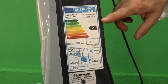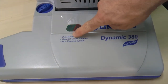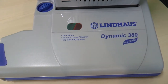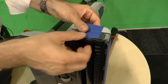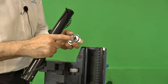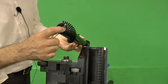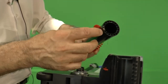Dynamic is a Class A machine for energy efficiency. Dynamic Echo Force is a dual-motor machine — it has a filtration system for hospitals and an integrated dry cleaning tool. It is a multi-function machine. Replacing the brush roller is very simple and done without tools: just remove the cup, push the brush roller across, and it is removed. Remove the side support, which has a rubber sealed bearing with an O-ring. All brush rollers are dynamically balanced.